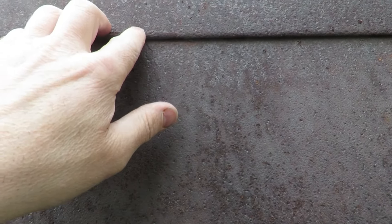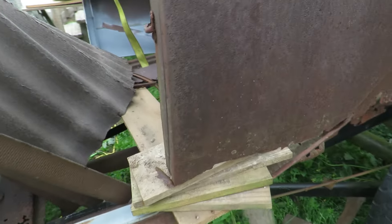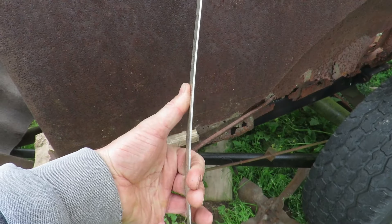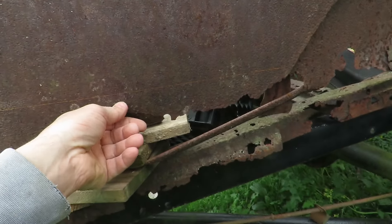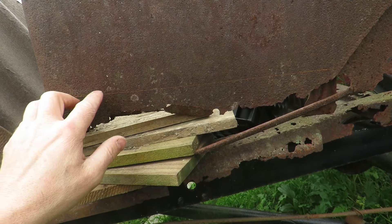Putting in the rivets actually closed up this seam right here — it was spread apart and it closed that back up. I am going to have to work on some of it right here on this little corner, as well as on the other side. I took a bendable ruler or yardstick that curves pretty good and I came off of this seam 17 inches down. As you can see I have a strike mark right here. This is not where I'm going to cut it right away — I'm going to make the other panel first and then do the final cut.